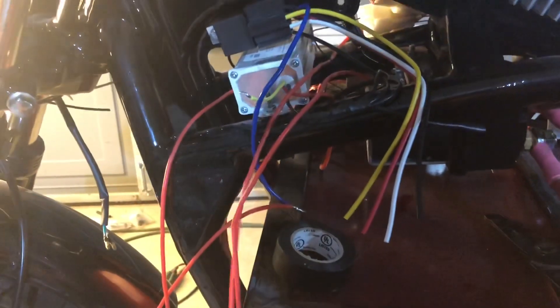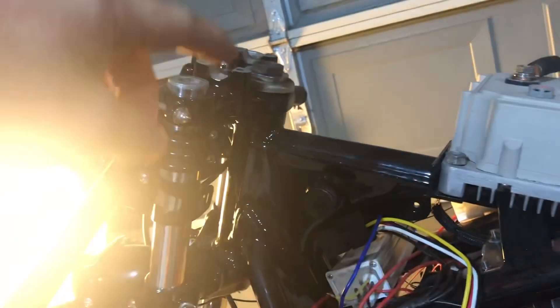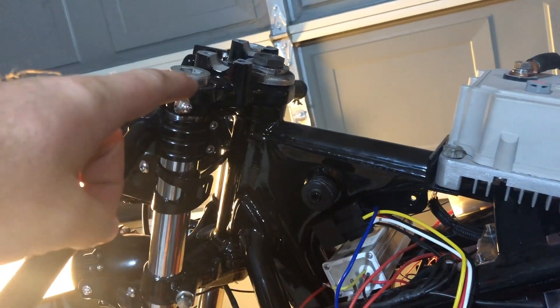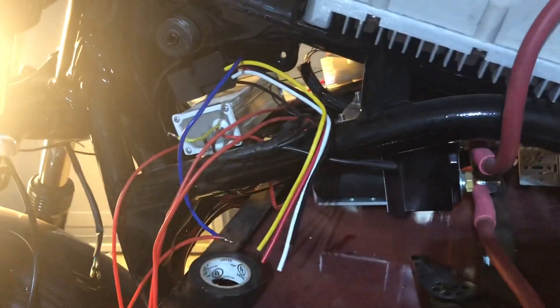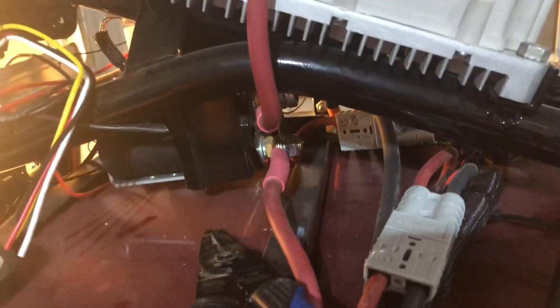I'll try to do a nice close-up of that as soon as I finish. I'll test the systems out to make sure they all work. I'm going to connect it up right now temporarily, but just through the relay - reason being we don't know where the key switch is going to go yet, it's still being figured out. Otherwise everything's finalized. Once I get this in, we can extend cables if needed to get the battery temperature, volts, and amp meters up to this point, and then start to do some cable management. We managed the cables on each of the sides so it's starting to look clean.